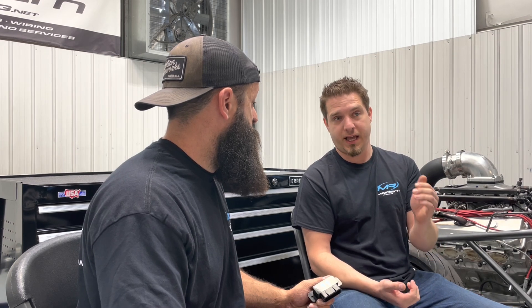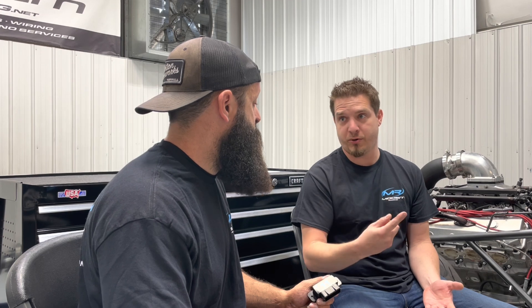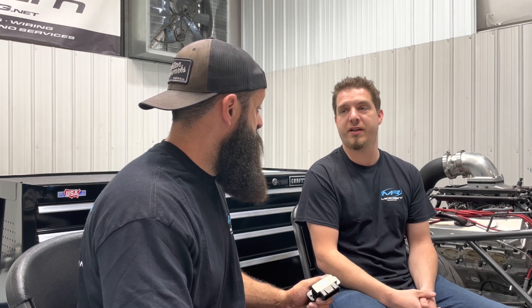Something we've seen and experienced — tire shake is really rough on components throughout the race car. So the fact that it double locks ensures you're not going to have anything rattle loose and lose those sensors in your data log on future runs. We use aircraft-grade connectors on there. There's a lever that flips over and locks, and there's a lock that holds that lever down. In the terminals themselves, you push the terminal in, it's got a lock that grabs the terminal, and then there's a secondary lock that holds all of the terminals in at the same time. And then there's redundancy on the circuit board — every trace connects and does all the splicing for you, and there's a duplicate trace on there in case one of those ever happens to fail.